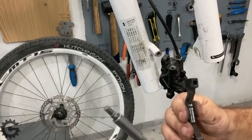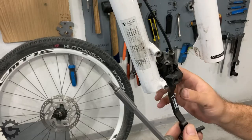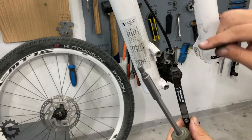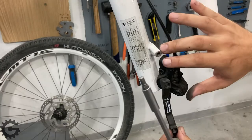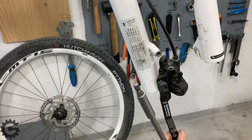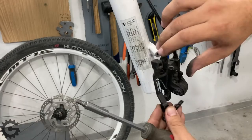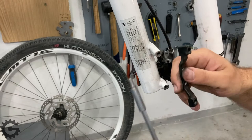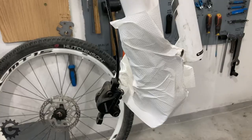Most of these — I don't know the English word for this, I would have to Google and put it in the video description — it holds the brake caliper and their orientation varies depending on whether it's a larger or smaller diameter disc. Also the model and shape varies because the caliper needs to be further out for a larger diameter disc, and it also depends on whether it is put on the fork or at the rear. Here Shimano made this for the front — the 'F' letter marks the front brake — so you cannot get it the wrong way. That's something to pay attention to when disassembling these brakes, because not all of them are properly marked.